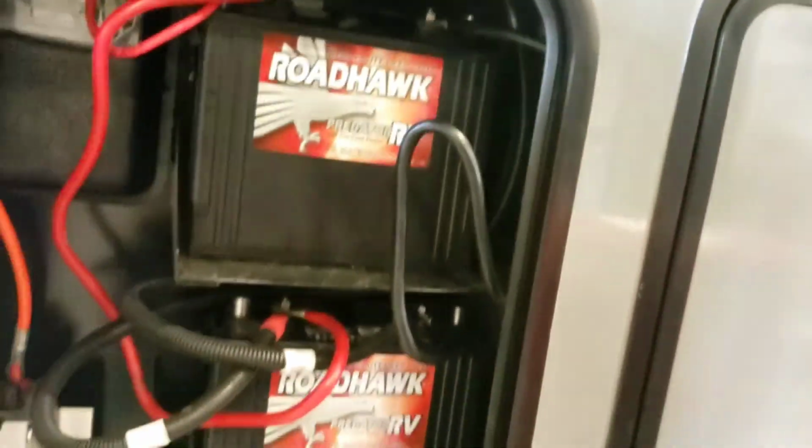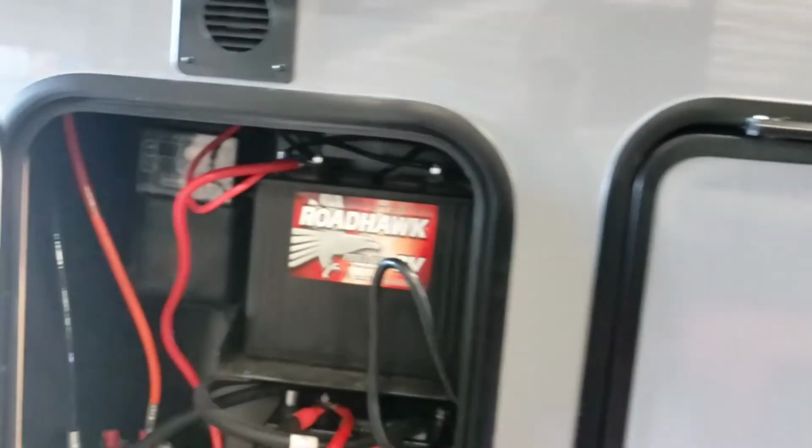Moving over here, because we have this trailer all set up, all the steps down, the back steps are down, I will not run the leveling system, but I'll definitely explain it to you. So your battery needs to be connected for it to work. Here's your power button here. Hit auto level right when you're ready to level it. When you're off of your truck, it'll start automatically leveling for you. Once it's done, it'll beep, and then you'll see success. You might even miss it, because it disappears off the screen and then goes back to level jacks down, and the jacks go all the way down.